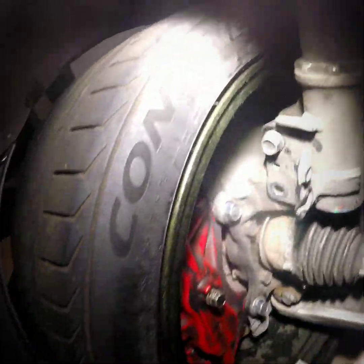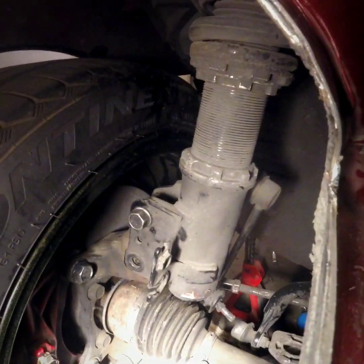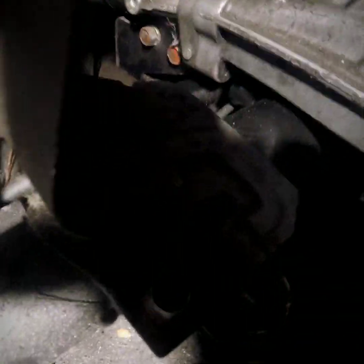It's never final building race cars - you can always take it apart and reiterate. That bottom hole is not lined up all the way so we need to get that lined up. Shout out to My Cars Premium Wheel Straightening - they do some amazing powder coat work. I need to get some Evo X lowers and then the bolt holes will line up. The Evo axles aren't stretching out - the stock axles are actually long enough. Stock axles, stock transmission, stock ACD - Active Center Differential. It has a transmission line that runs from here all the way back to the pump in the trunk, and that controls the amount of pressure pumped to the front and center differential to transfer the right power to the right wheels.